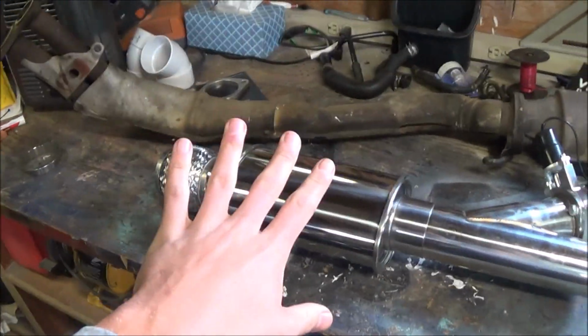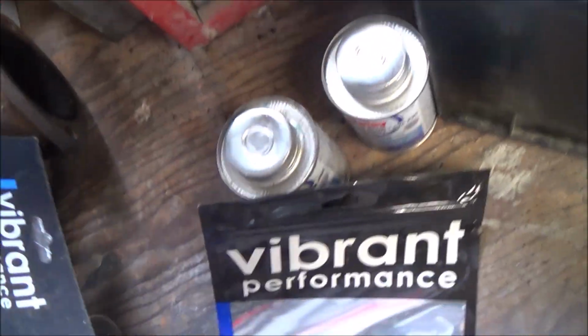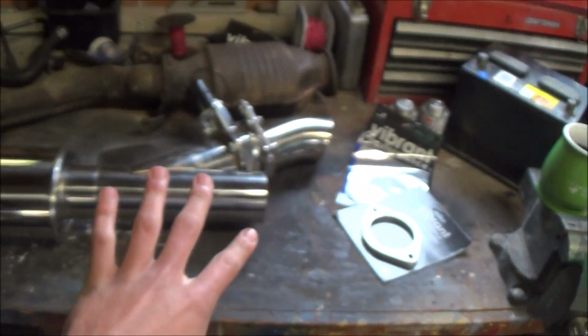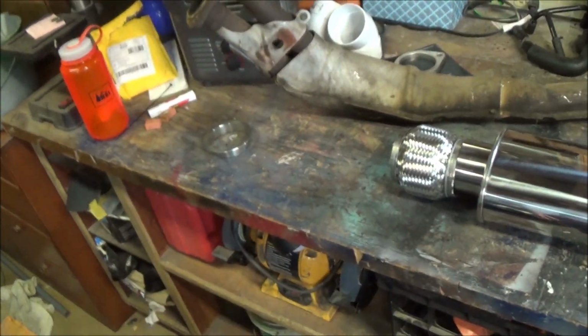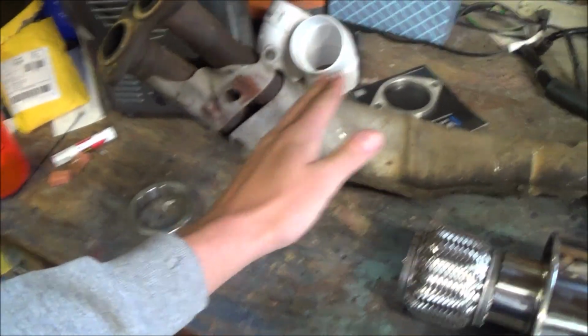So this is the reference that we're kind of building slowly off of. We're not trying to copy this at all, because different engine, different exhaust setup, but this is so you guys get a picture that this flange will come onto the end here, pretty much replace this old cat one here, and then it'll come all the way up, follow the same idea, and then build up into the downpipe, because that is near the same spot the headers kind of ended off. We'll probably go about right there.